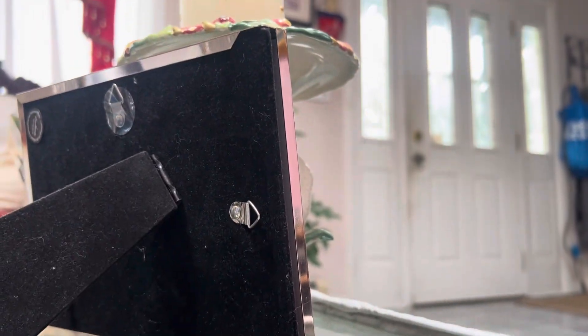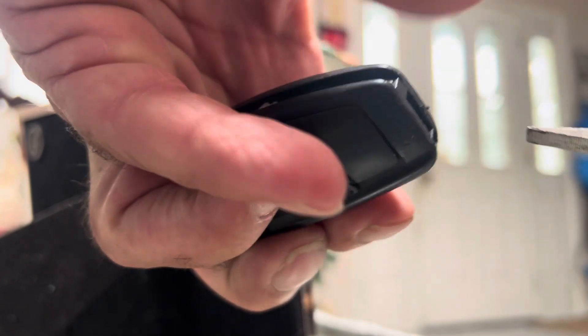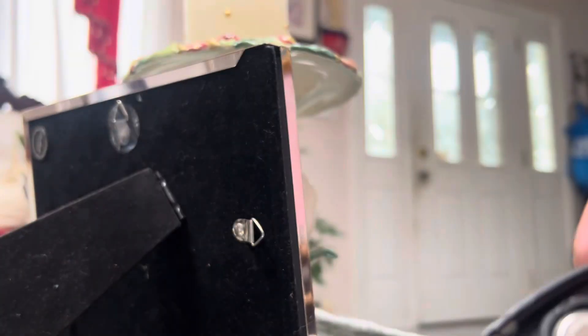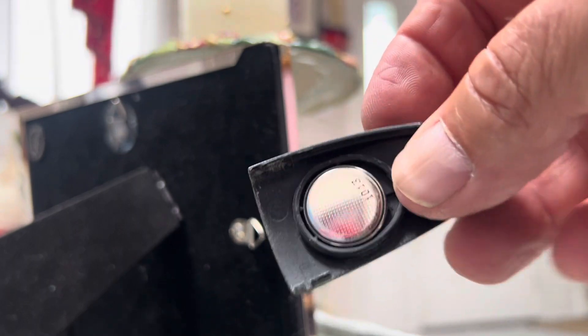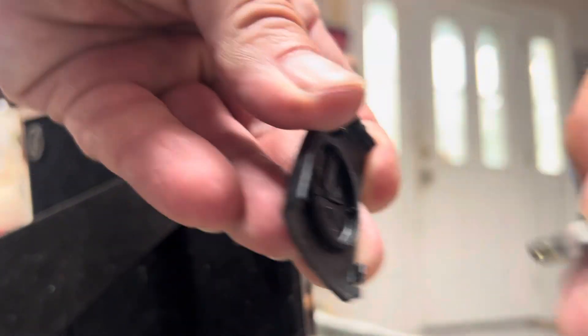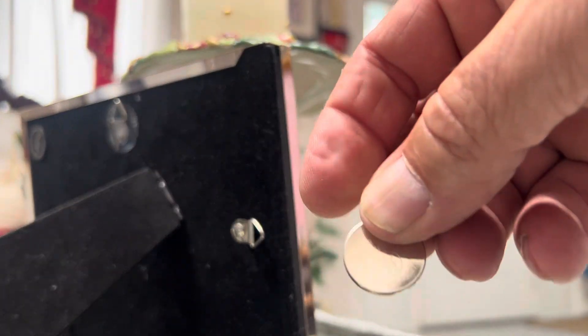Let me place the phone in a balanced position so I can show you how. Normally there'd be a piece of metal around here where the key hooks up, but that's broken off this remote. So you get a screwdriver, pop that open — it's a little bit stiff — get that out. Now there's the battery right here. Note the way the battery goes in: the smaller part, which I believe is positive, faces you. Just lift the battery out.